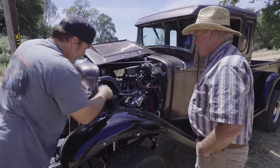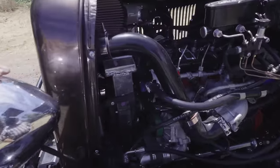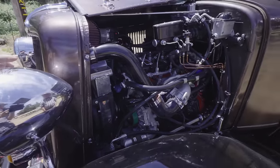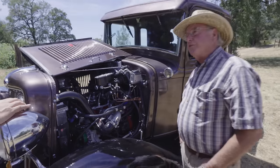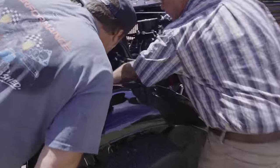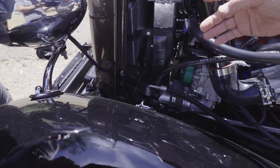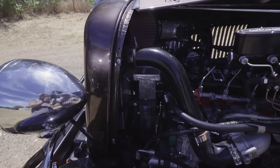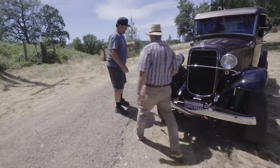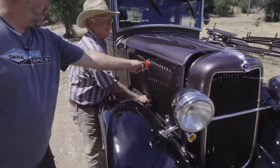That's really tight, but it looks good. The radiator is out of a Massey Ferguson tractor. Most truck and car radiators stop at about 18 inches in width, but tractors you can get down to 15 inches wide, so it's narrow and tall — still a four-core. I needed something narrow to get inside of the steering gear since the steering box is very close to the radiator. We've got the intercooler, and in front of that is the air conditioning radiator. On the other side you can see a small turbo spinner in there.